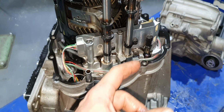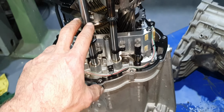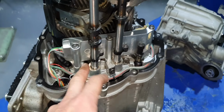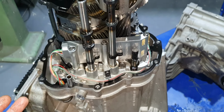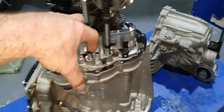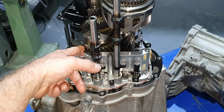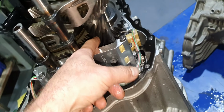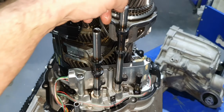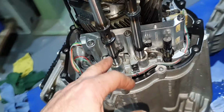Because Omar, he made a test on the jack, he was shifting the gears. So most probably he shifted this gear, I don't even remember which gear that is. Why did it stay? It's supposed to be neutral all the time. And when I open the cover, I pull it up. So worst case scenario, you can engage this gear, but not this one. This is supposed to be the first gear. It looks like the first gear, right? Output shaft, input shaft, big gear, smaller gear. There is none smaller than this. Yeah, this is like the first gear.